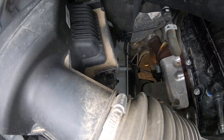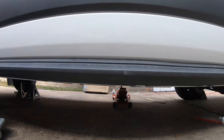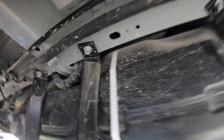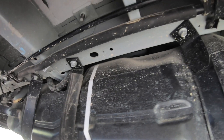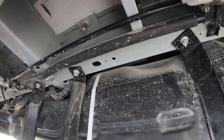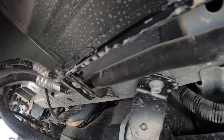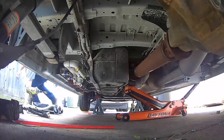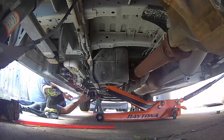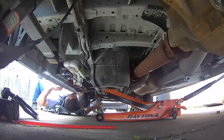We are about to drop the tank and install the secondary fuel line. I've got to hit all these bolts — there are six in total — then drop that tank down. I left the two front bolts in and loose so the whole tank can pivot backwards, giving me enough space to reach in and do what I need to do.